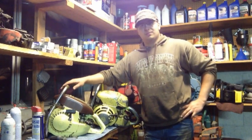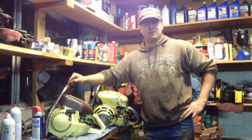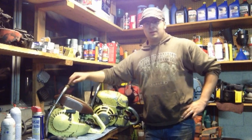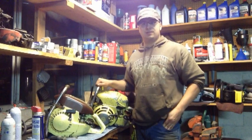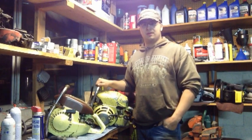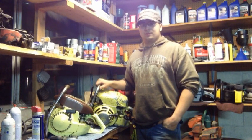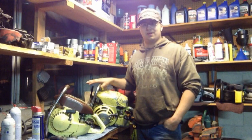We're going to probably hook them both up with brand new bars and chains. The original bar for this one seems to be okay. At the bare minimum, I'm going to get a new chain for it. This one here, I'm thinking of setting up with a 32-inch Oregon bar with a 404 tip. And of course, it'll be 63-gauge 404. That was the longest guide bar that they supplied with these back in the day.